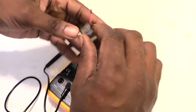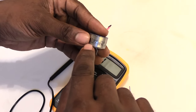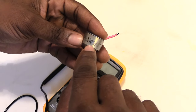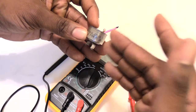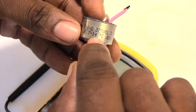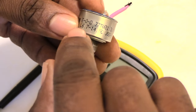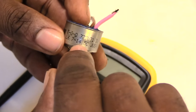If you look at the side of your defrost thermostat, you'll see numbers on it. This one says L6.7 dash 14.5 Celsius. You'll either have Celsius or Fahrenheit. What this is telling you is the temperature at which this defrost thermostat either opens or closes.